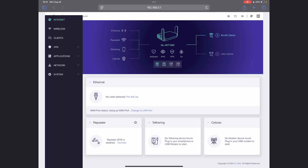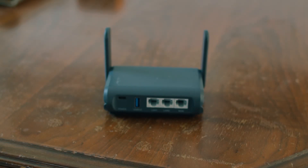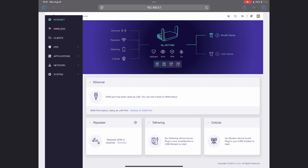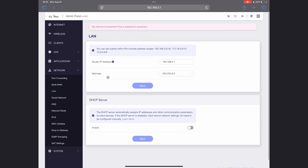The first thing I'd like to do is change the WAN port to a LAN port — I'll click this and apply. Now you can use all three ethernet ports on the back of the router the same way; you don't have to worry about plugging into a specific one. Once that's done, go to Network and go to LAN. Here you'll set the router's IP address — here's the little bit of networking.